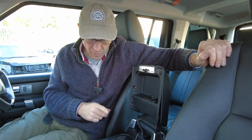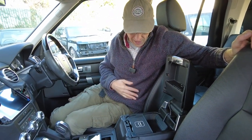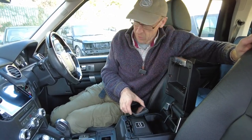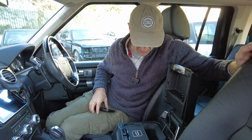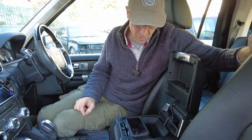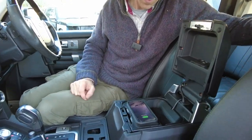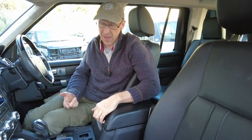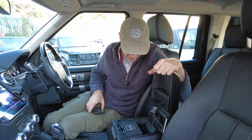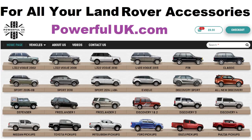We should be all ready to go. I don't think that port becomes live without the ignition on. There you go - your phone is charging. Just check you've got clearance there. So there is your Range Rover Sport, Discovery 3, Discovery 4 wireless charger and lid, all installed.